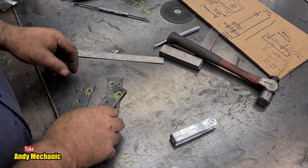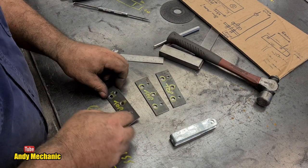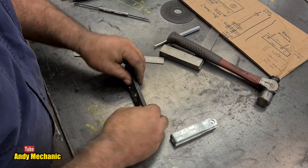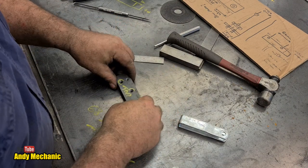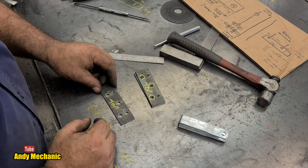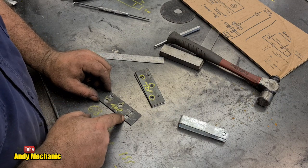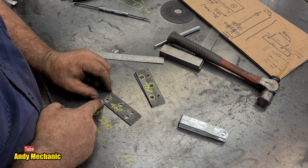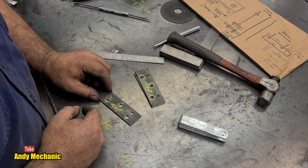Right, so what have we got? The master now, that's the one we're going to sandwich in the middle. So hopefully all these holes will line up. Oh, it looks pretty good to me. Okay, so only the middle one is going to get the two little slots cut in for the cable. Now we know the cable is 2.1 millimeters in diameter, so I need to cut some tiny slots in there with the slit disc, which are 2.1 mil wide. That'll be fun.